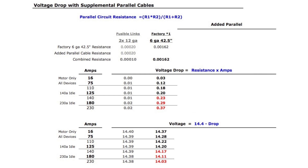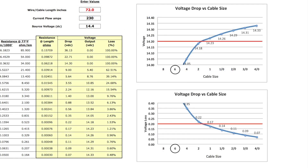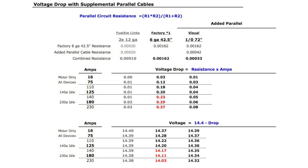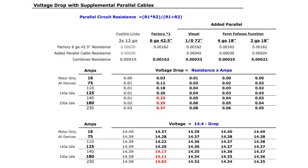Now that we know the cable's true resistance, we calculate the actual values. Most of the time it meets SAE values, but at 140 amps, we are just outside the limits for the rare times we would generate that much current. Adding the visual 1-aught cable of 72 inches in parallel changes things — an 8-hundredths of a volt drop. That's way better as a parallel cable than what we saw as a single cable: 14-hundredths. Parallel cables share the load. And the 4-gauge short cable does better by a minuscule 2-hundredths. A 2-gauge does as well, but it's not significant. Length of cable means more than diameter.